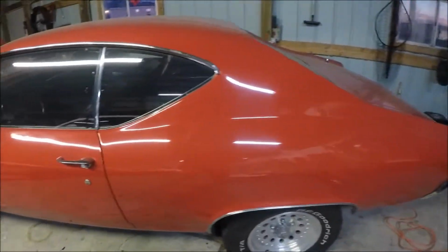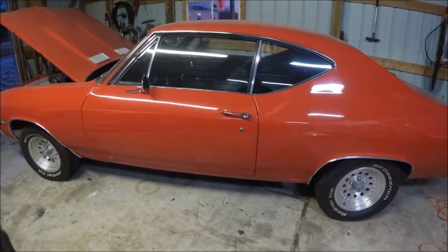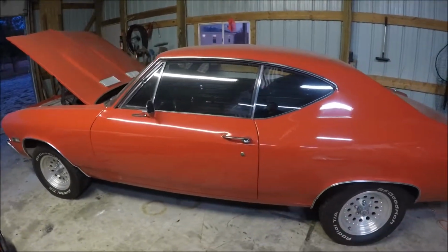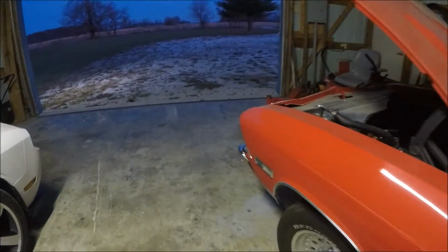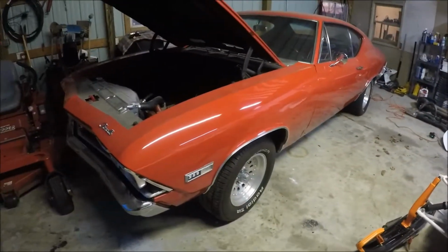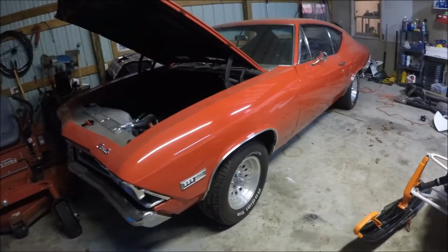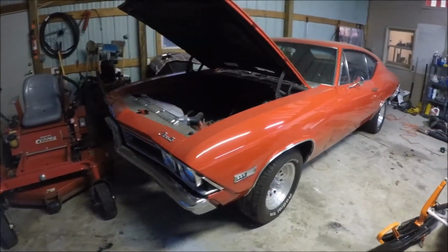All new suspension, UMI Performance 2-inch lowering suspension, and I got their stage 1 handling kit, which includes springs, sway bars, polyurethane bushings for both sway bars. Everything else I kept rubber bushings, though. I've already rebuilt the front end, new control arm bushings, new ball joints, all that stuff. So did all that. I'm getting new rear control arms as well. And actually, I'll just read down the list here because, like I said, it kind of turned into a whole project.